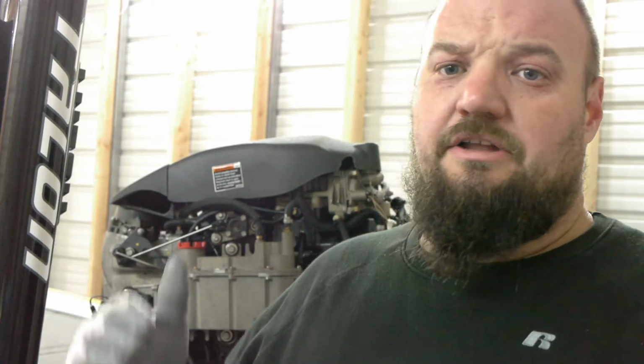I know how I treat my fuel. I always run 92 ethanol free. What a lot of people don't understand is the newer motors, when you don't run the higher grades or the cleaner fuels, your motor will detune itself and you won't get the maximum performance. There's a census out about fuel, but that's a whole other story. So to make sure my motor's running good and happy, I changed the plugs, and I don't know when they were changed previously.